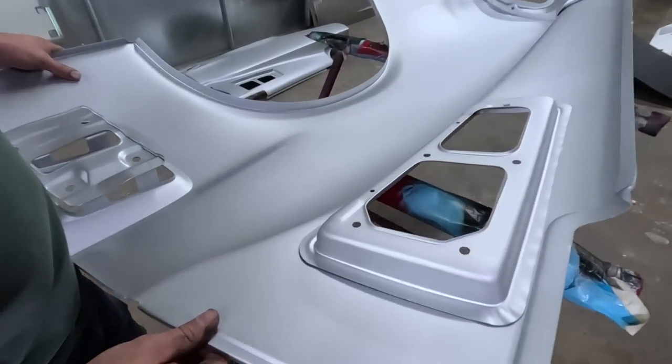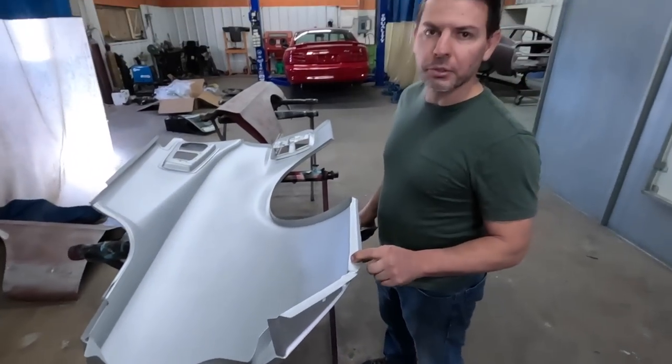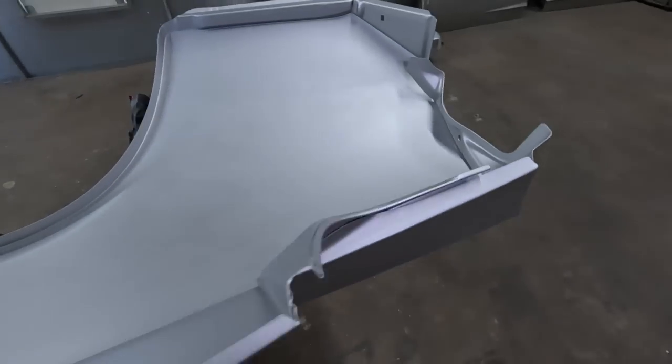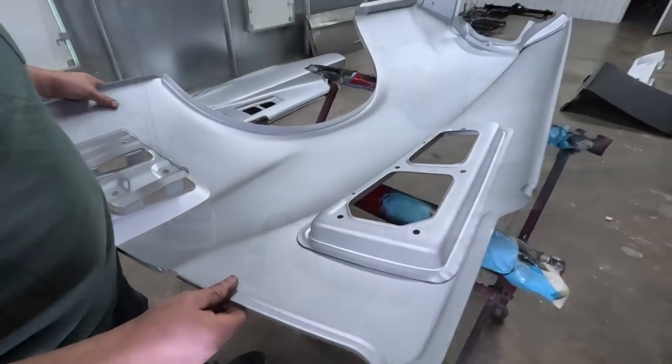Are these painted or what? This pure metal? It's a weld-through primer. You can just weld right straight through with a MIG welder. Now, spot welder, you gotta clean it. The factory installed these quarters with mostly spot welding, some MIG. There's also some brass involved and lead.